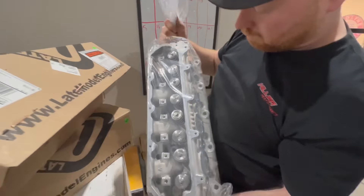We have a Brian Tooley Stage 2 turbo camshaft for this engine. That thing should sound and thump pretty good. We also have the billet LME front engine cover with VVT delete and the chain guide, which eliminates the factory chain guide. We're doing all the DOD delete stuff and putting Johnson drop-in lifters in — not the short travel ones. This truck is getting good parts and is really going to make a lot of power. We want to build it so you can go out and beat on it with no issues.